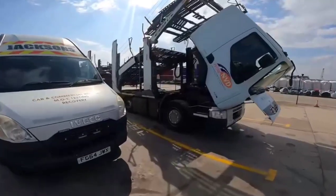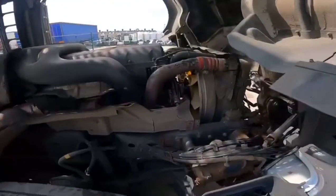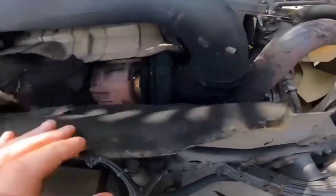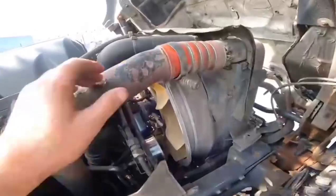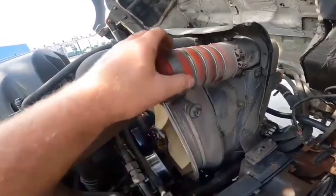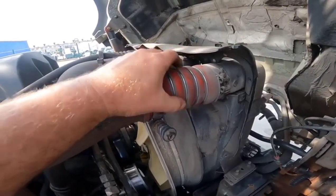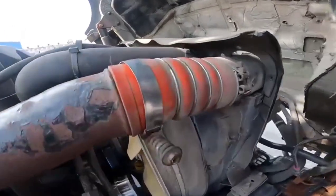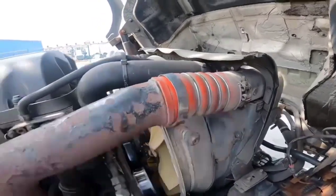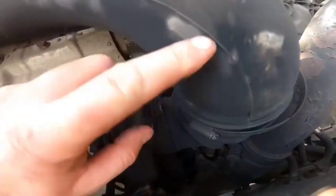Right, and guys, I'm on site there now. Got this Renault Premium, cab's already up from last night. So what's happened is when you rev it up, I've undone this clip, I undid that last night, but when you rev it up, normally these boost hoses really bulge out with the pressure from the turbo, but they're not. That's his fault. He's got very little boost. So if you follow it back down there, you see all this black on the turbo. That's your telltale sign, you see.